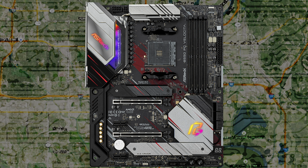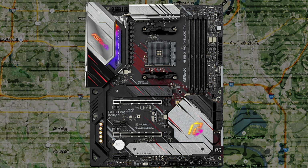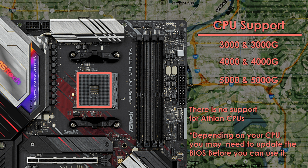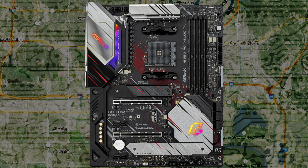Starting with the form factor, the ASRock B550 PG Velocita is an ATX motherboard and measures 12 inches by 9.6 inches or 305mm by 244mm. The motherboard supports a wide variety of CPUs, and depending on the BIOS that comes with the motherboard or that you've installed, you can use almost any Ryzen 3000, 3000G, 4000G, or 5000 and 5000G series CPU. Zen and Zen Plus or Ryzen 1000 and 2000 series CPUs do not seem to be compatible with the PG Velocita. For a complete list of compatible CPUs and the minimum BIOS version you need installed to use them, refer to the link I've provided in the description.